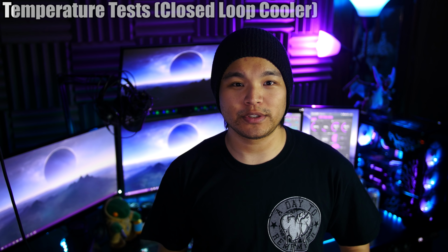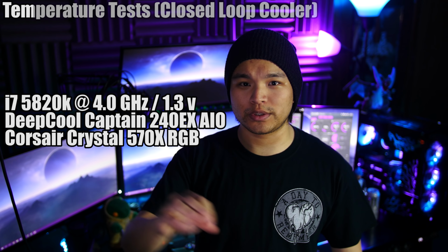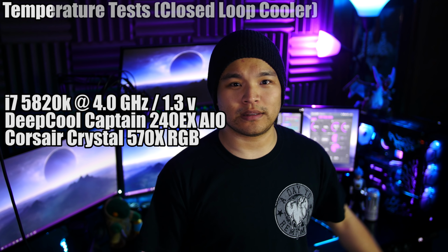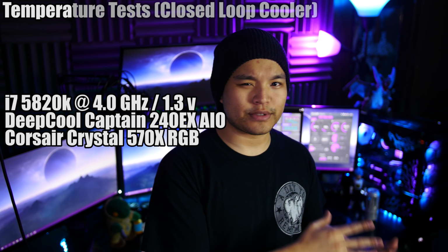The first configuration we'll use consists of the i7-5820K CPU clocked at 4GHz at 1.3 volts with the Deepcool Captain 240EX all-in-one cooler. The case will be the Corsair 570X with its front panel and dust filter removed, so there is nothing impeding the airflow except for the radiator itself. I won't be using exhaust fans, so we'll be ignoring the graphics card for our radiator test.